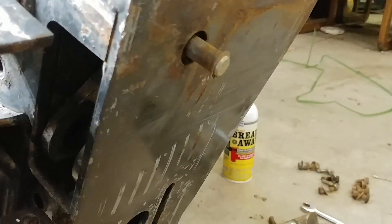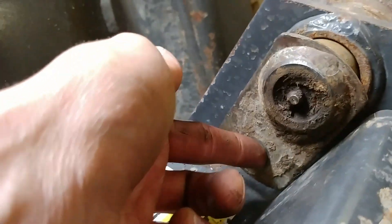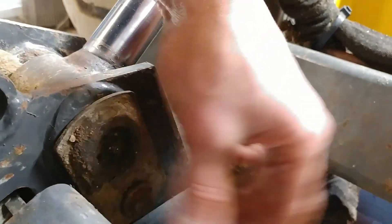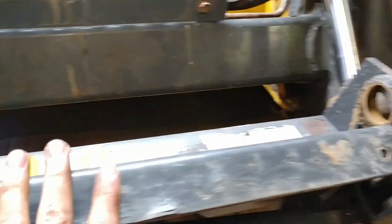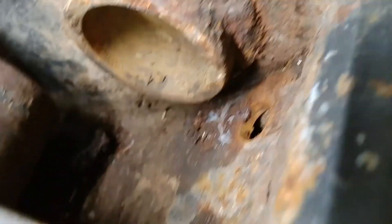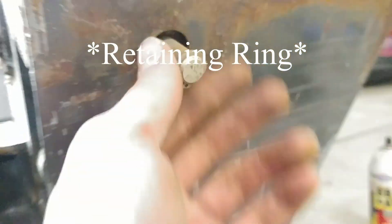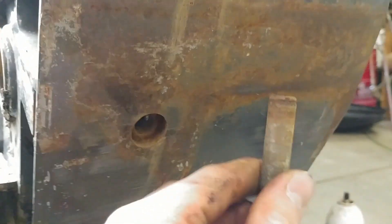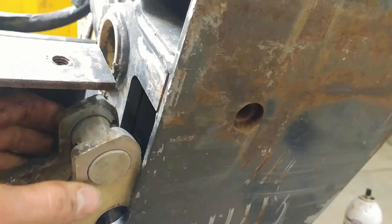In order to get the other pieces out the top, we need to pull this entire triangular block out — unless the bolt's broken, which it was in my case, so the pieces could come out one by one. You're going to have to disconnect this arm; there's one bolt right here on the side that's still attached. Take out that bolt and then pry and pound and pull until you get this thing popped out. That drops this arm. Over in here you can see there's a hole — that's where there's another pin that the triangular block pivots on. It's got a tiny little key on it; get it popped off and then you can tap that out or pull it from this side. That should release the whole block so you can carefully pull it out.